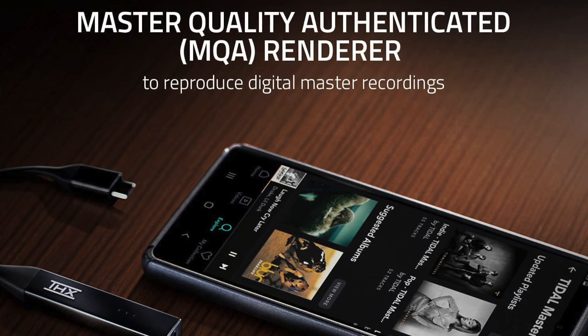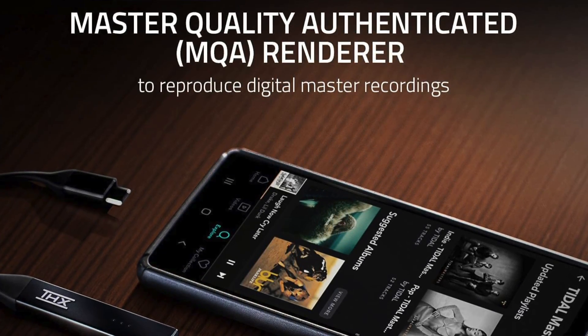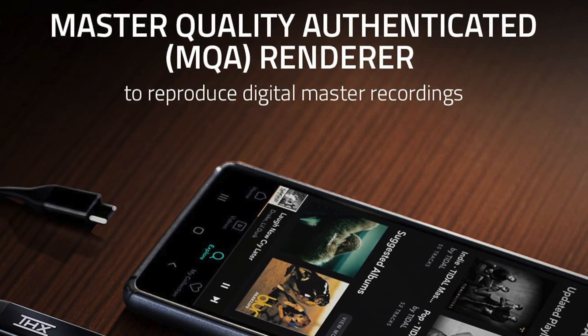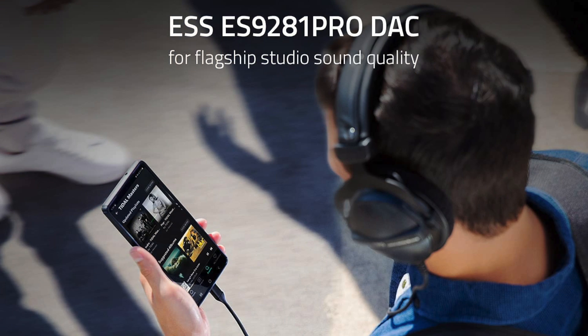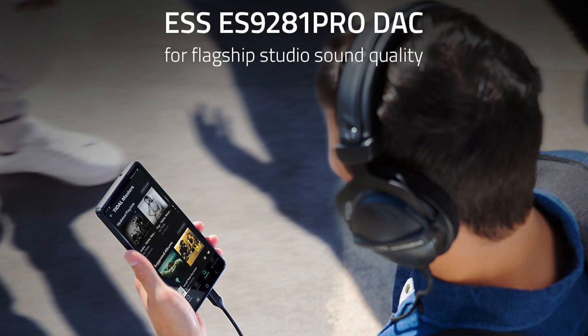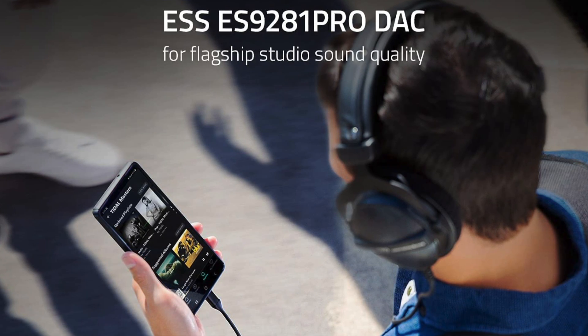You might be wondering what MQA stands for — it stands for Master Quality Authenticated. This means you are getting an audio codec with lossy compression and a form of file authentication intended for high-quality audio streaming. The only thing you need to know is you're not going to have any distortion and your audio is going to sound crisp. The THX Onyx also includes an onboard ESS chip as well as full THX AAA support — patented technology from THX that provides a power boost and ultra-low noise distortion.